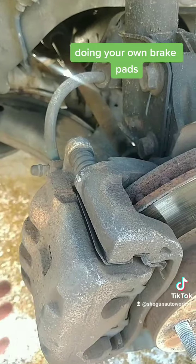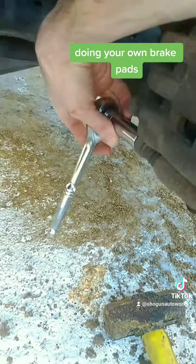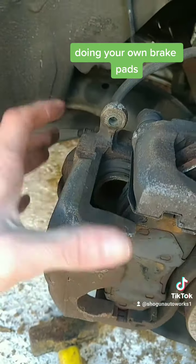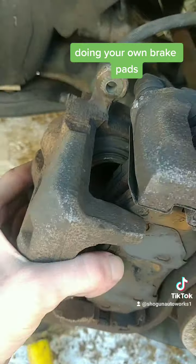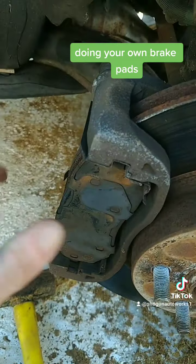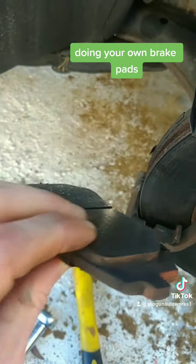So we're going to do that now — get these little bolts loose so I can slide that out. Don't be afraid to bump on that handle with a hammer if you need help breaking it loose. Sometimes they're pretty tight. Had to beat on it a little bit up top and on the side, tap it to get it unstuck. But there you go. Take the caliper off, and there your old pads slide into those little clips with the ears.